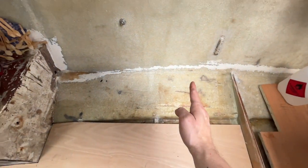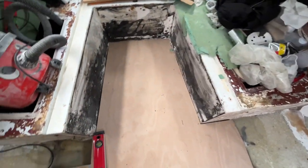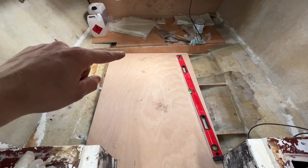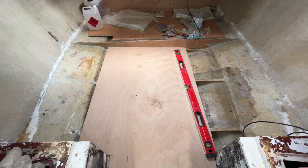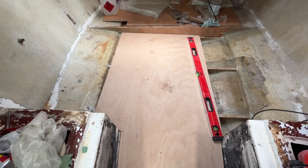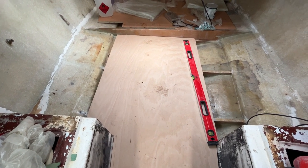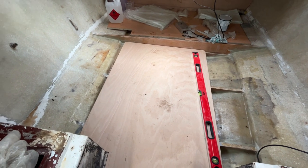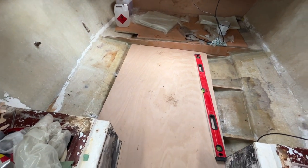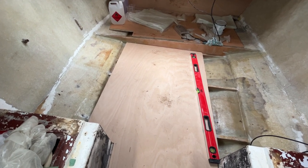The kitchen will maybe start from about here - I don't need a big kitchen. I've finally got a floor in, nice and solid. I'll crack on and cut that bit and that bit and that'll be that floor done. I am going to resin wash this board - only carpet sitting on it, but if I resin wash it it'll be waterproof and I don't have to worry about it. I'll resin wash underneath and probably even bilge paint the bottom so it's a sealed unit.